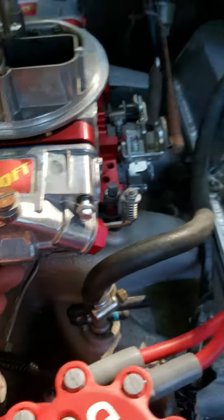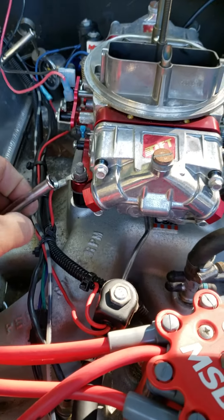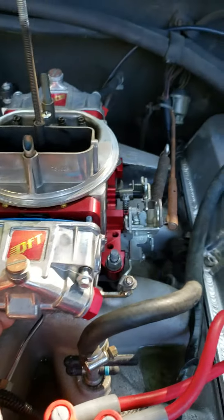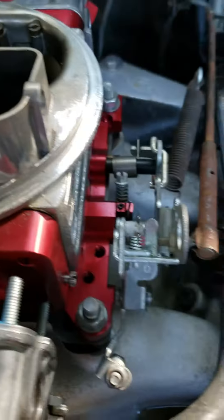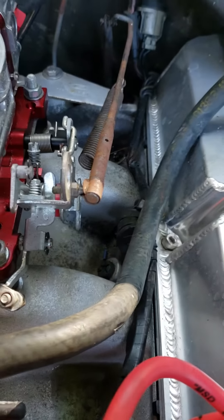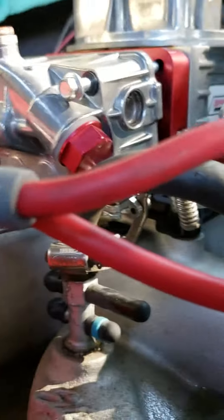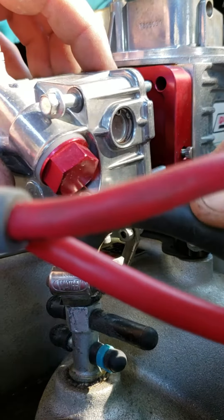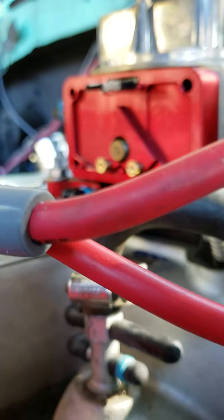Basically what you'll find out: you pull these four bolts off the front, after of course unhooking these two lines here. This will just drop for the little booster pump, or it will fall down. Just watch your gasket and ease it out of there — just like that.